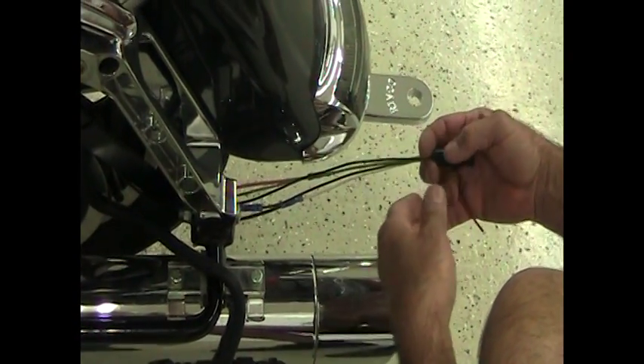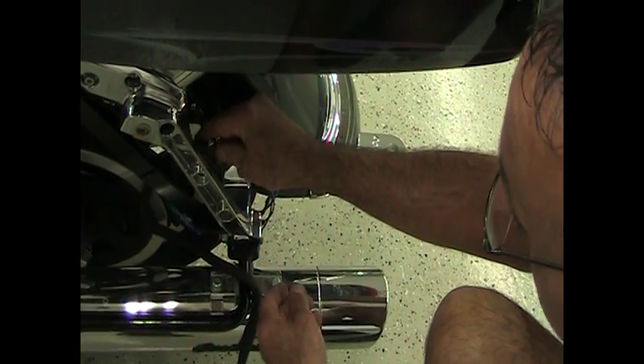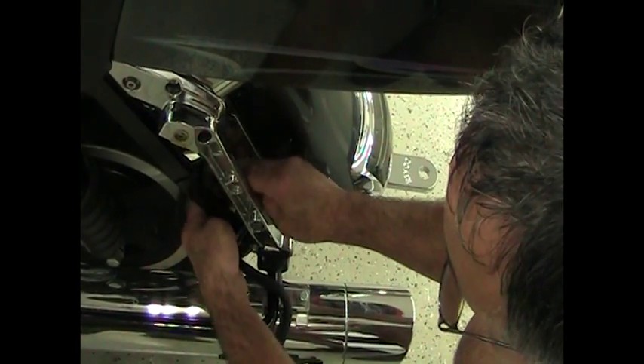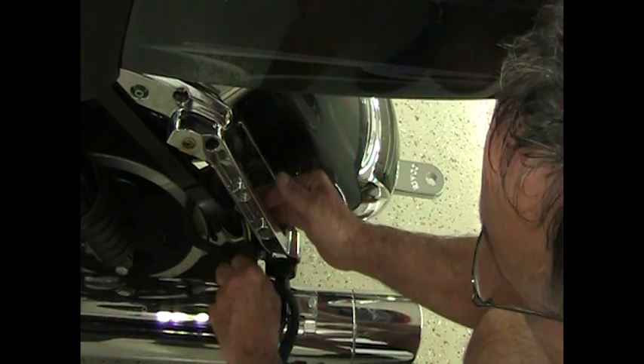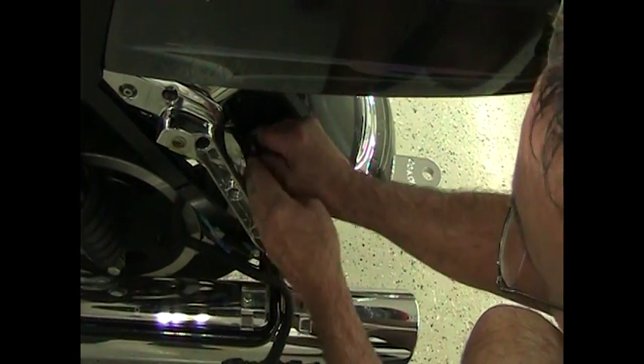This is a five-wire system so we're using a six-wire molded plug, with one unused wire flipped out. We've made our connections using butt connectors, staggered so you don't end up with all connectors in one place creating a big lump. Put the sheath back on and route that back underneath and you'll have the plug you need for your trailer. When not towing, you can stow the plug up in between the saddlebag support rail — some people add a piece of Velcro to hold it in place when not in use. We recommend a free plug on the wire rather than one that mounts to the ball so you can still remove the tongue.